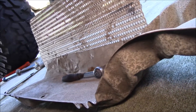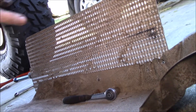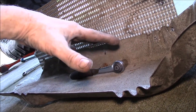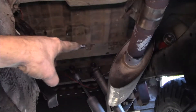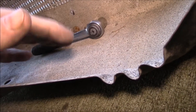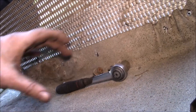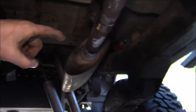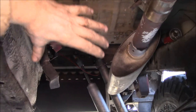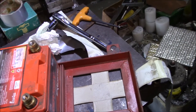This is the modification I did to the muffler heat shield. I added some aluminum that was left over from my in-window solar heater project — I stuck those pieces together and pop riveted them to the heat shield. That heat shield goes right up here and kind of covers the muffler, keeping the muffler heat from coming up through the floor. My old muffler ran down here as a cylindrical shape, but this new muffler sticks down quite a bit farther, and the battery is right about where my hand is — I think the heat got to it.